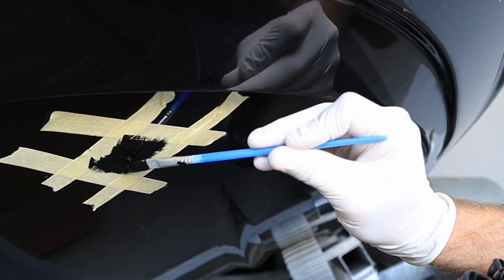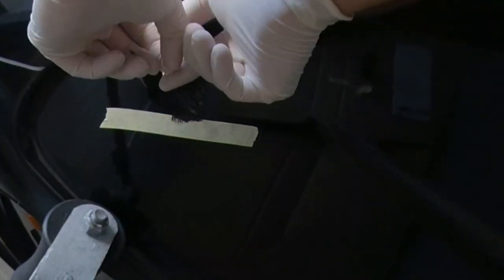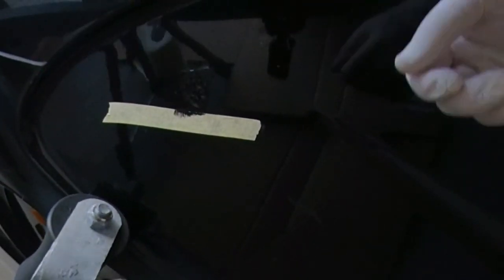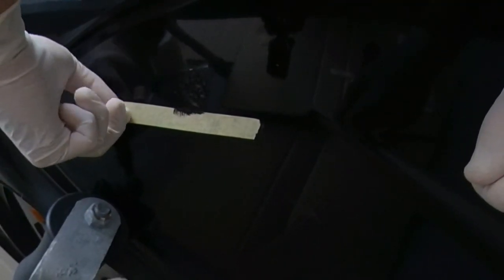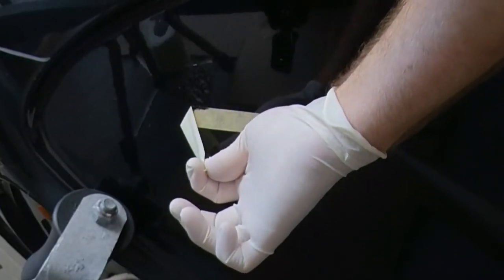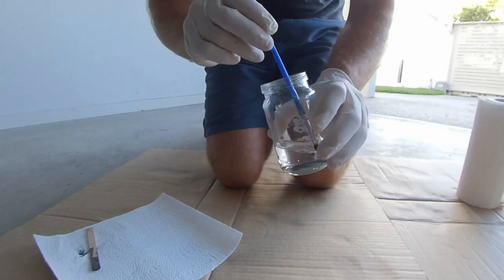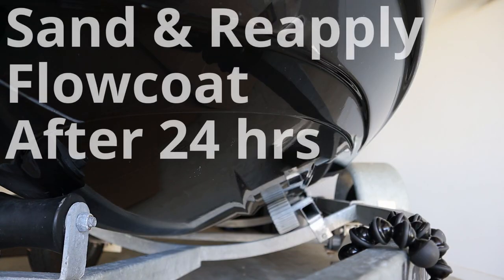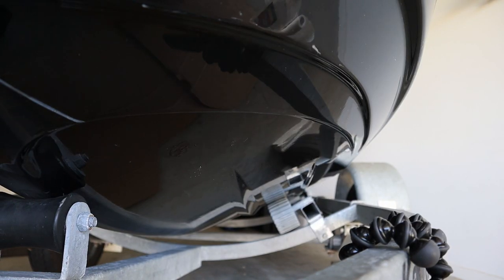It is now advisable to remove any masking tape so it doesn't become stuck to the repair. Clean up your brush and measuring spoon in a jar of acetone and leave the flow coat to fully cure overnight. Even though this chip was only a millimeter or two deep, I needed 3 layers of flow coat to